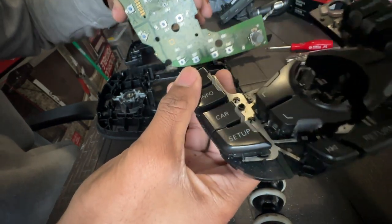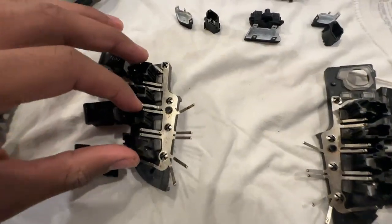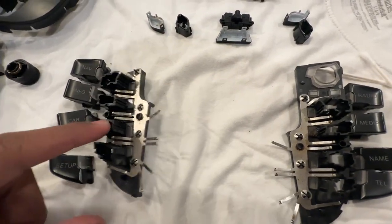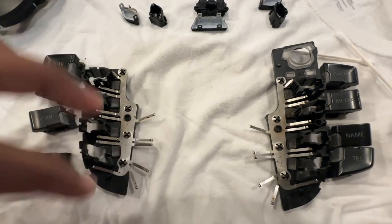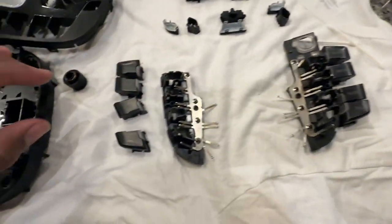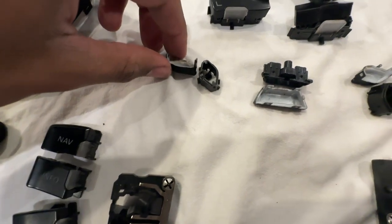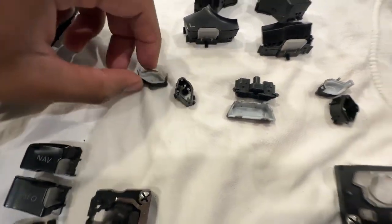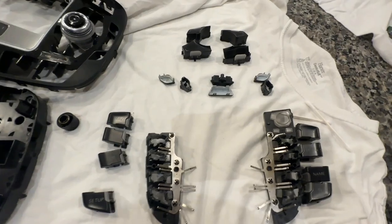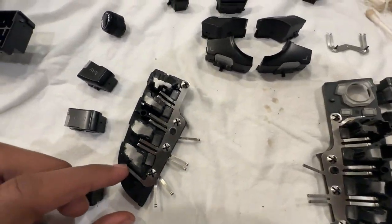Hopefully this makes a difference. The circuit board was pretty easy, but this is the worst part right here. I took all the buttons off of the MMI controller button panel section — these just break right apart, there's the centerpiece over here. I'm going to take these buttons apart also; there are little caps on here, so I'm going to clean all inside there and then put everything back together. Here's all the buttons cleaned up — go ahead and put everything back together.